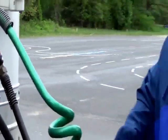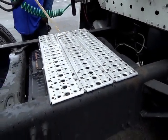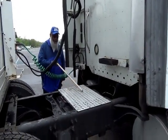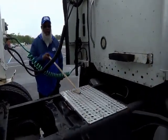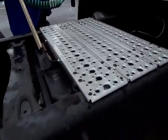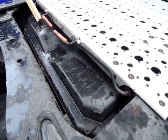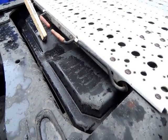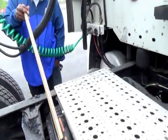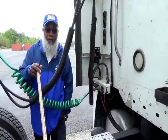Move down to the catwalk and your step — not cracked, not broken, and secure, no debris, no illegal welds. Underneath that is your battery box — not cracked, not broken, and secure. Inside the battery box are your batteries — not cracked, not broken, and secure, no leaks, no corrosion around the posts. Your cables are not cracked, not broken, and secure, not dry-rotted or frayed.